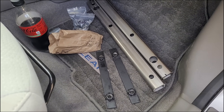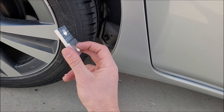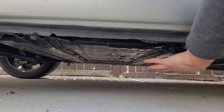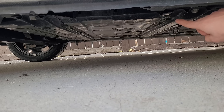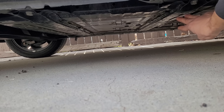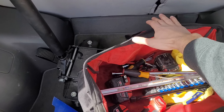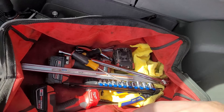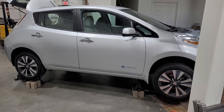These are extensions I made for the rear mounts on the battery to drop it down 40 millimeters — you'll see those being installed later. Since I already took off all the undercover shields it should be simple: 8 to 10 battery bolts coming out and then three connectors. I've got the trunk fully loaded with my jack, jack stands, and all my tools. I hope this is everything I need because I'm driving there and won't be able to go anywhere else for supplies.